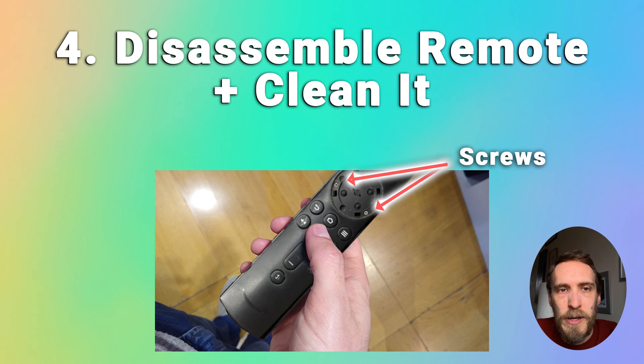It's pretty easy to disassemble these Toshiba Fire TV remotes. First, take the batteries out, then remove the central button wheel by using a flathead screwdriver underneath to prise it off. You'll find a couple of screws underneath. Once you've removed those, pop the remote into two halves — a front and a back. Take out the individual circuit boards, give them a clean with isopropyl alcohol, remove any dirt or gunk from the buttons, put it all back together, and hopefully your remote will be working.